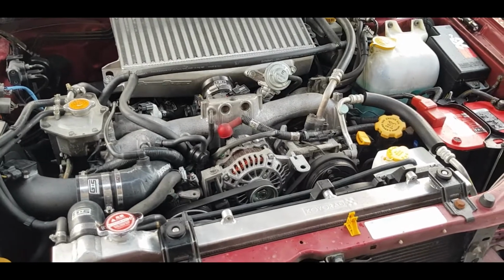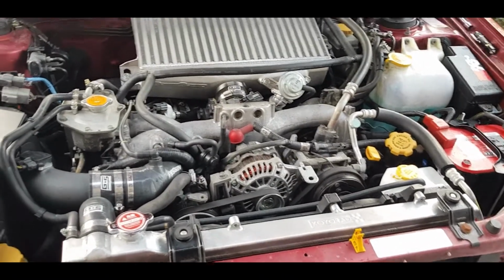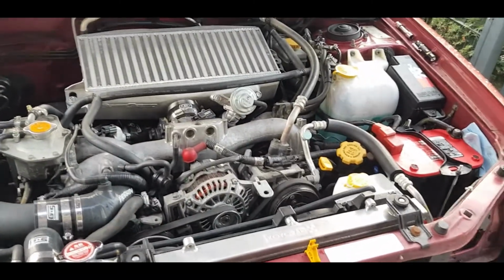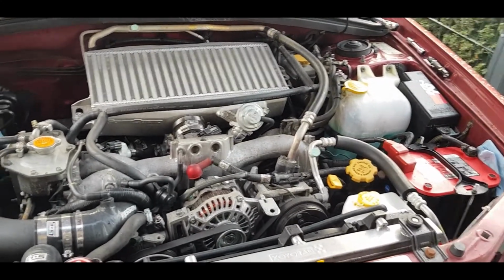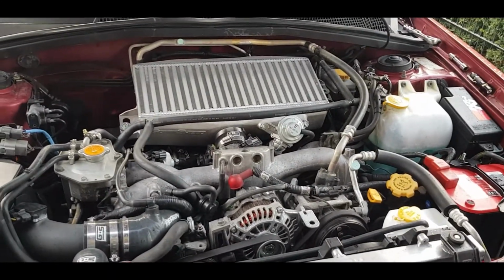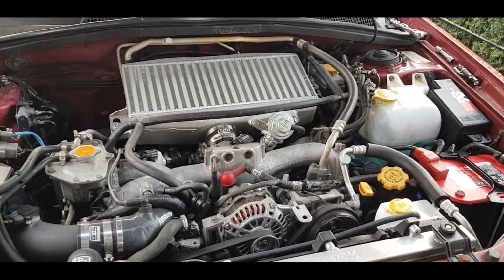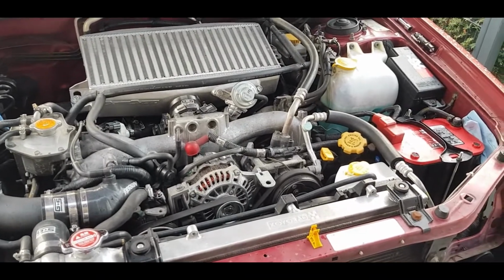And being from California, it has an uppipe with a cat, a crossover with a cat, and a downpipe that has cats. So the thing would not get up and get out of its own way. I spent some money and upgraded the exhaust. There's a turbo-back exhaust from the downpipe. I put the stock muffler on it because I didn't want anything crazy sounding, no drone as I'm going down the road. I like it. It's quiet, and it's clean under there.